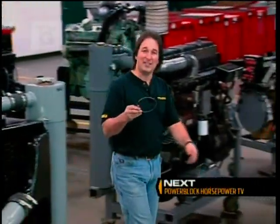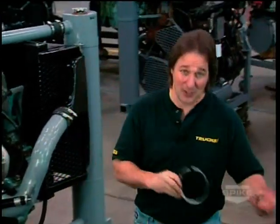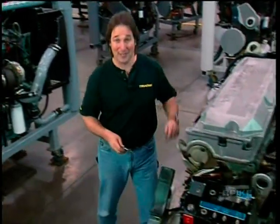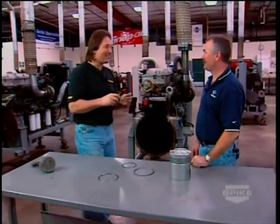One of the most important components in any engine is the lowly piston ring — it's also one of the most misunderstood. It's just a little piece of metal, but this is what builds the compression in your engine. In a gasoline engine you might get 180,000 miles before you need new rings; in a big rig diesel you might get 800,000 miles. So what's different, and how does it work? That's what we're going to show you.